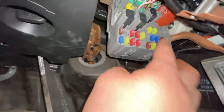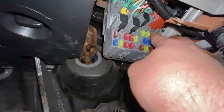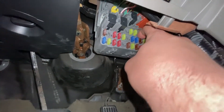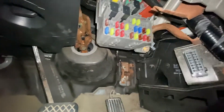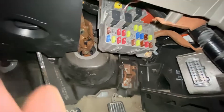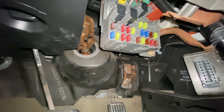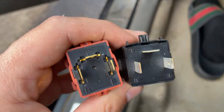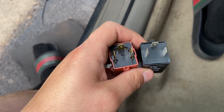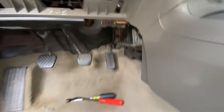You're going to have to get down under here — here's the relay. It's just going to have two clips. You're going to want to peel back one on the bottom and one on the top, and it should slide right out. The top one is a little bit more tricky to get to. Once you get that off, it should be ready to get the new one in. You want to compare the two and make sure you're putting it in the proper way with the prongs facing the same way. Now that we've got the relay nice and secured, we're going to go back around to the engine bay fuse box.